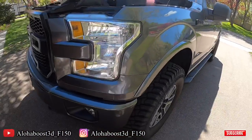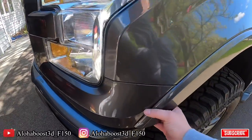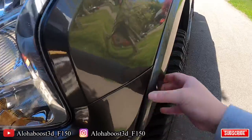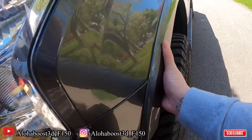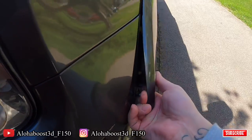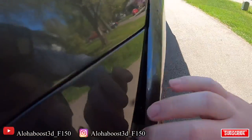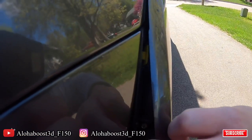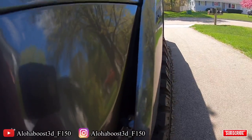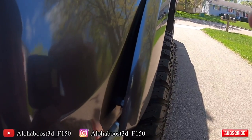All right, so now that the fender is loose, we're going to slightly pry this. It's out. You've got to be gentle on it. You do have these little push clips right here. There's one right here, it's kind of in there. It's yellow right there. Those kind of break off, so you have to be careful. So we'll pull that off and move on to the next step.